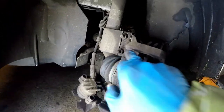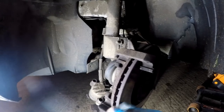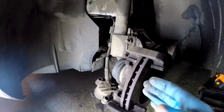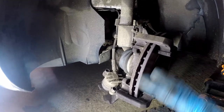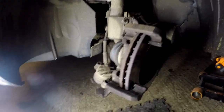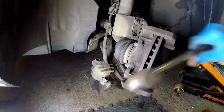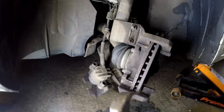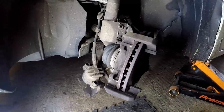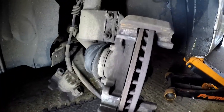Next job, I'm going to clean this up with a wire wheel, make it look nice and clean and remove any loose metal. I'm reusing the discs here because there's hardly a lip. If you've got a major lip and they're very worn, please replace the disc with the pads — that would be a different episode, a little more expense and work. If there's loose metal, just tap it free or use the edge of a hammer or screwdriver to remove debris built up over time. These discs are in good condition, cleaned up with a wire wheel on a drill, a scraper, and washed off with brake clean.